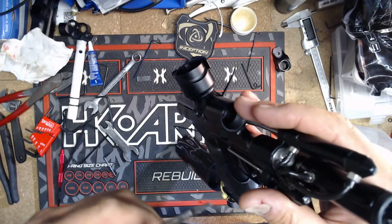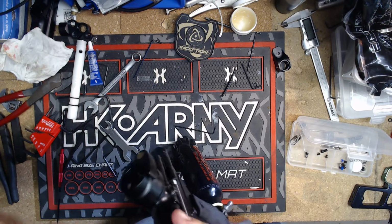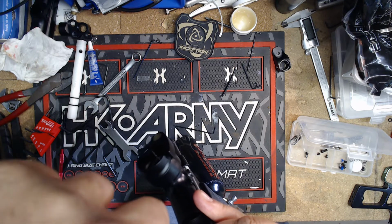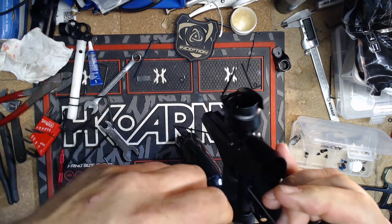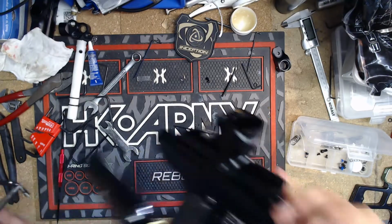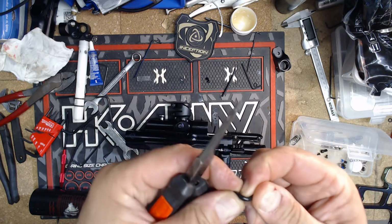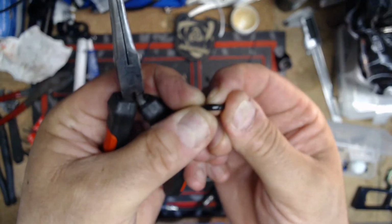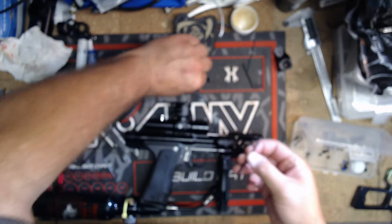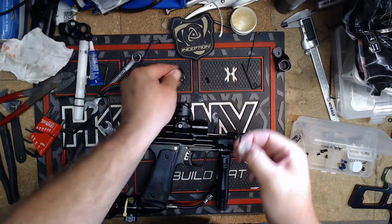So I'm going to replace this upper hose, or the rear ram hose. Oh, it's on there tight. Okay, there's that one. Take out those two little collars. Let me look at this guy. I think he's ripped here on the side, tell you the truth. Oh yeah, I have a hole. So that's where the leak was. It wasn't anything with my timing. So let's just kind of measure that out right about there.